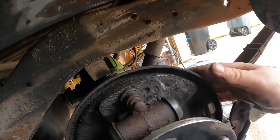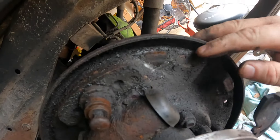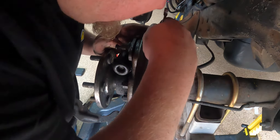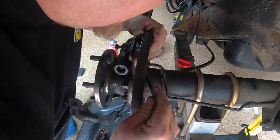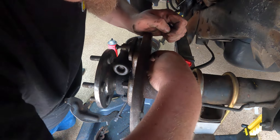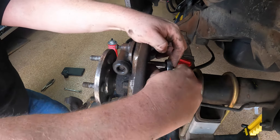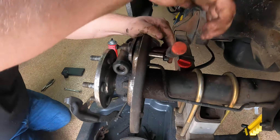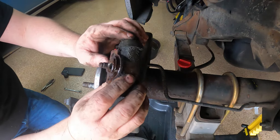I'm going to clean everything up after I pull the cylinder off because it's really nasty with deposits. Let's get this wheel cylinder out — it's a three-eighths wrench. Going back on the brake line here, carefully loosen it up. Back it all the way out — and two three-eighths headed bolts hold it in. Don't lose the bolts. Pop it right out and it's all wet — yeah, it's been leaking for a while down here.